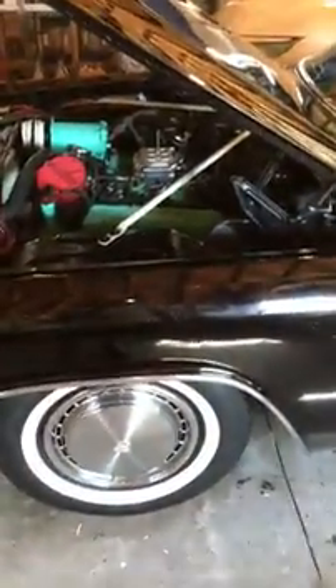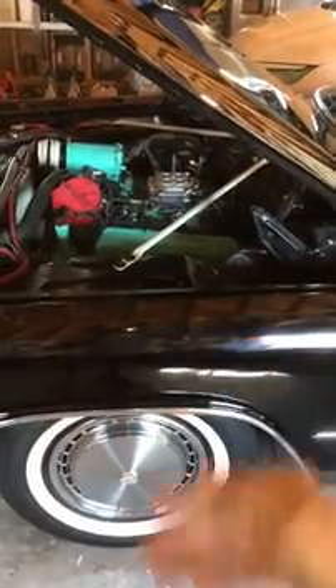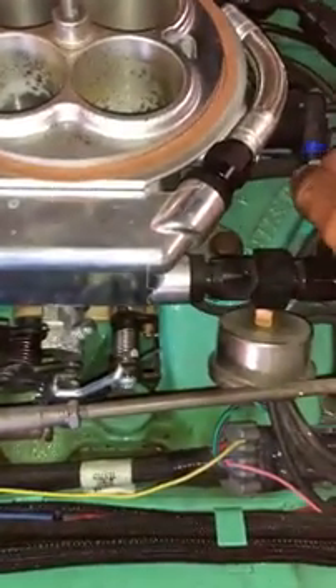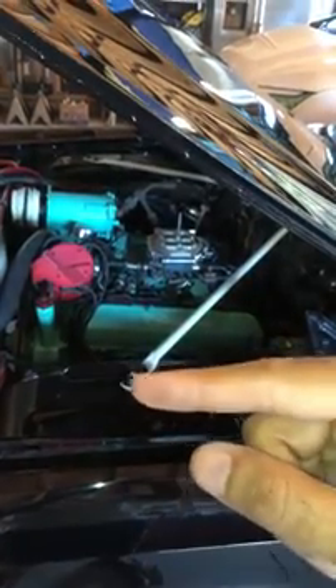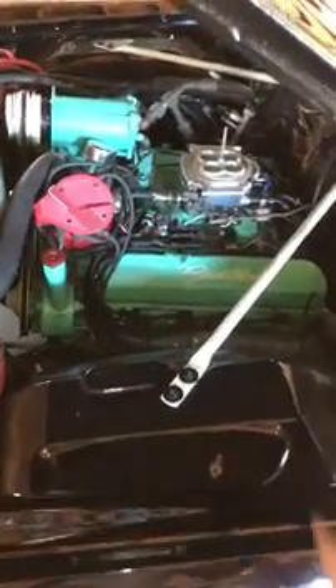Okay, I see what's happening. When I unplug the IAC at the high idle, the stepper motor gets stuck there, so it's letting that extra air in. I need to unplug it when it's at 0% IAC. I tried to unplug it when the IAC motor was at 0% so the needle was pushed in — and there you go, there's my solid idle again. Closed IAC.